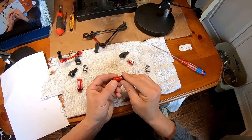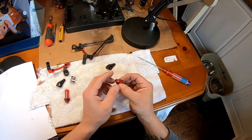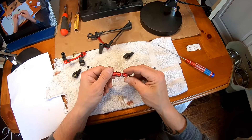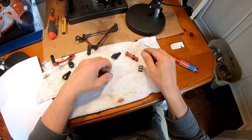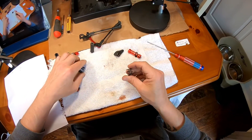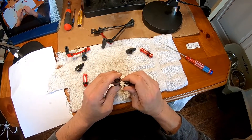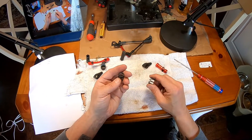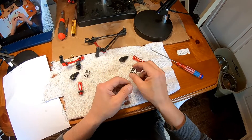So those are your options. They show you a picture with this little rubber gasket seal and you think maybe that'll keep it from backing down — but honestly I don't even really know what that's for. This thing is meant to be screwed together tight, loctited, and it stays exactly one length. I believe the spring stayed the same, though it's really hard to tell by feel. This one feels a little springier than this one, which feels pretty stiff — and that's the one that came off the old style.